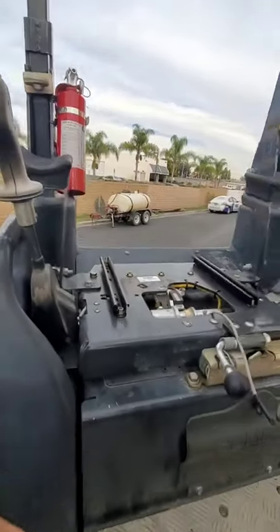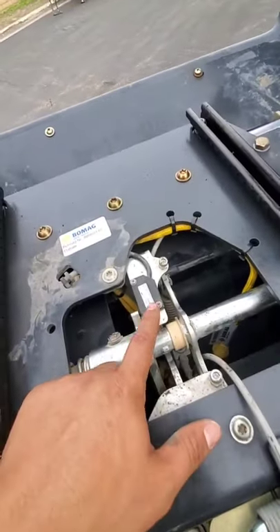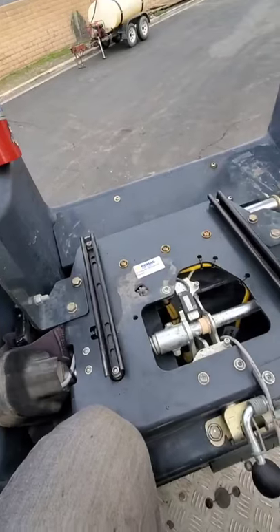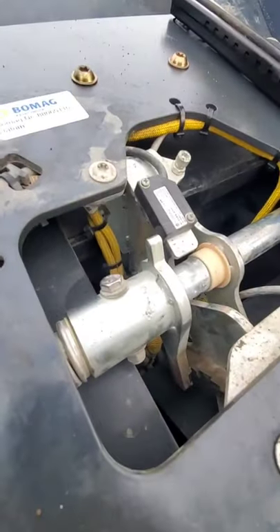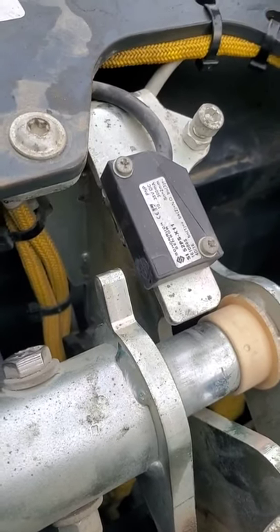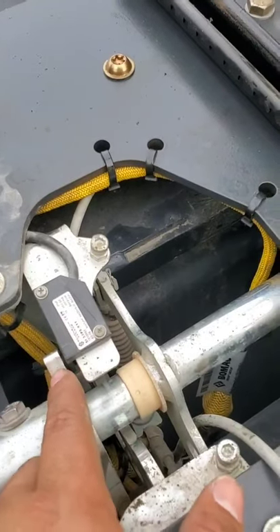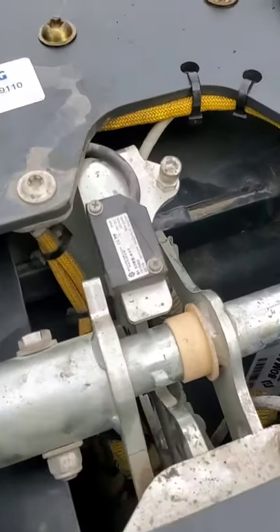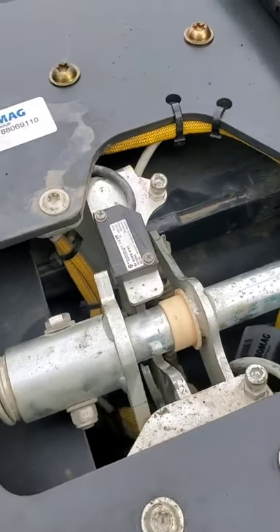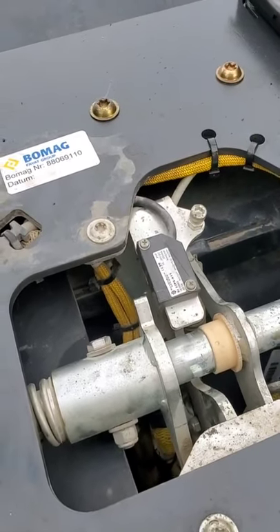That'll give you access to this center section. I'm going to show you what was wrong with mine. This sensor here — I'll show you the lever — you can see where the mechanism moves away from that sensor, then it goes either front or back. Zoom in — that's the sensor right there, you can see that little cross. Basically what I had to do was move my sensor away from this metal piece, so that when I move the lever it's far enough away that it doesn't read the mechanism and doesn't engage the emergency brake.